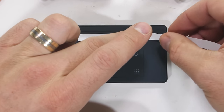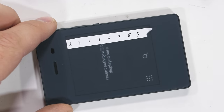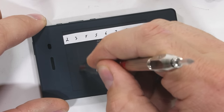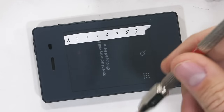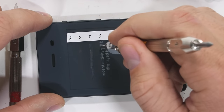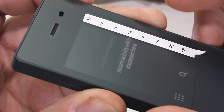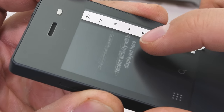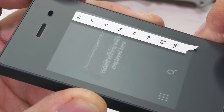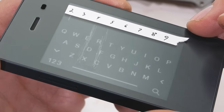The Light Phone 2 has that electronic paper e-ink screen that's just shy of three inches. At first glance and first touch, I thought the screen might be made of plastic, which usually scratches at a level 2 or 3. But it turns out it's using a frosted, roughed up glass layer that's acting like sandpaper to my Mohs hardness tools. You can see markings at levels 3, 4, and 5 — these aren't scratches though, just permanent dust streaks from my picks. The screen is still pretty resilient from actual physical damage, but if left alone with your keys or coins, it's going to get superficially scuffed up in a way that's difficult to clean.